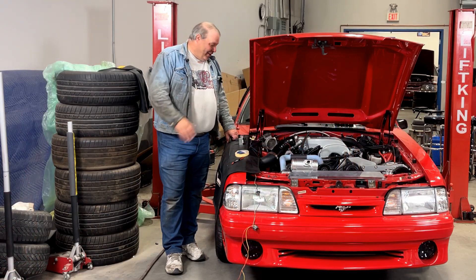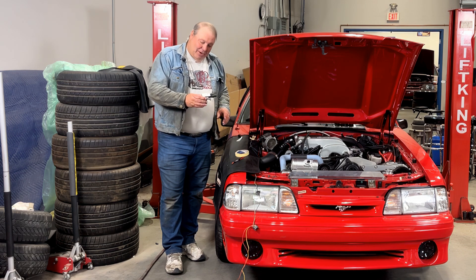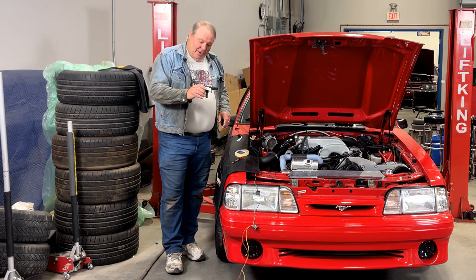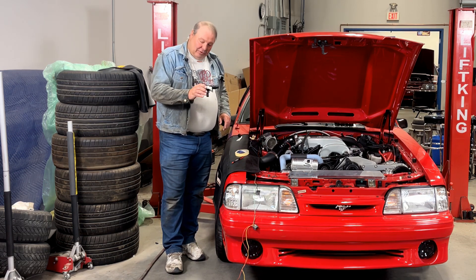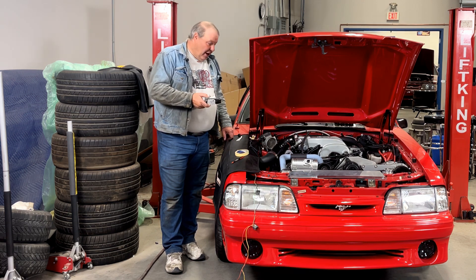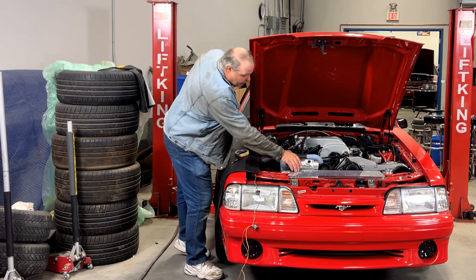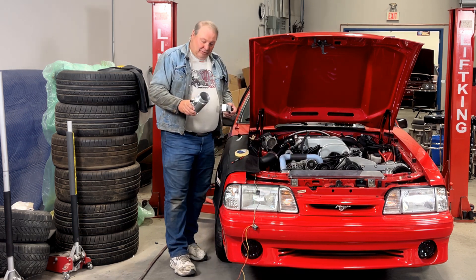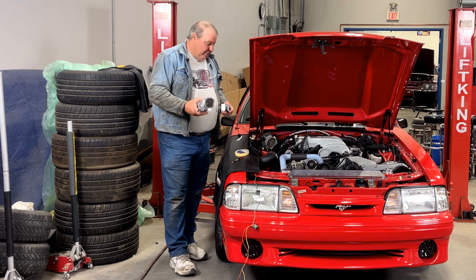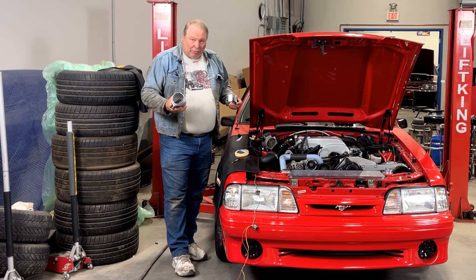In the case of this particular car, it actually had a pretty big meter — one of these Pro-Am calibrated meters, calibrated for 60 pound injectors, in a three inch Pro-Tube. This is actually the original tube it was in, and that was set up in a D1 Pro-Charger application as a blow-through setup.